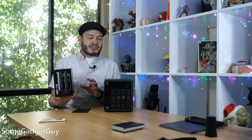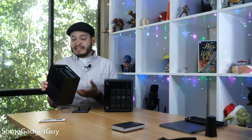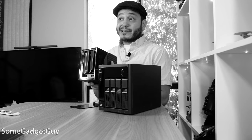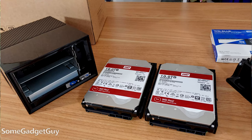He sent it over to me. I plugged it into my PC and started transferring over some of my video project files from past reviews. Same thing — the tiny little fan that's only in the top of this casing is not really sufficient to move all of the heat out of two big, storage-dense drives working in tandem. This really drove home for me how much I like Western Digital drives, the actual drives that go into their products, and how I'm just a lot less impressed with their enclosures for those drives.